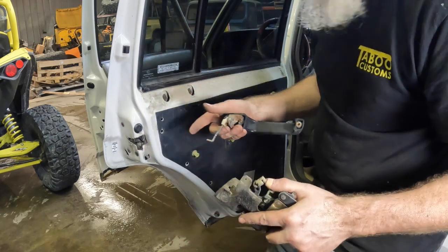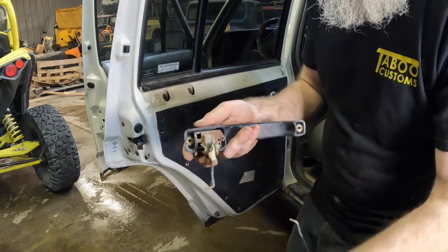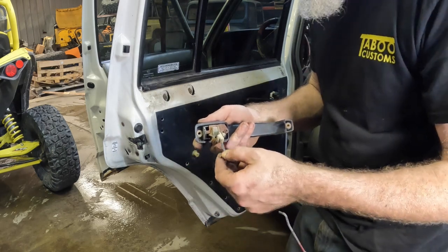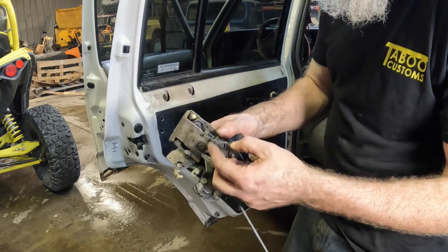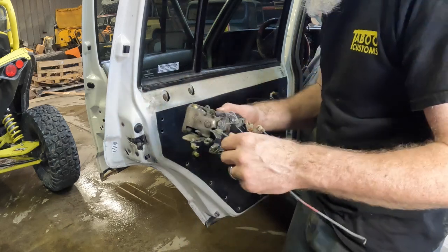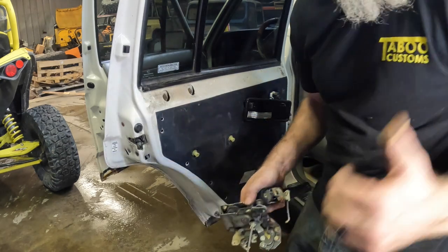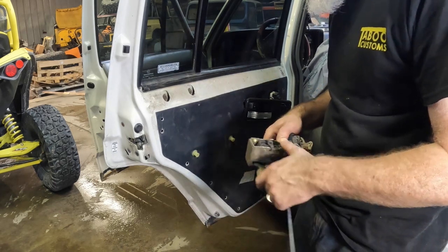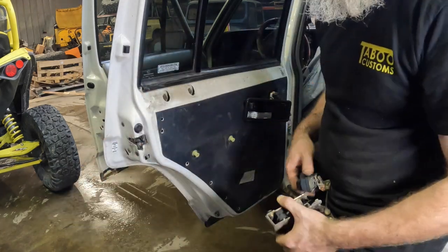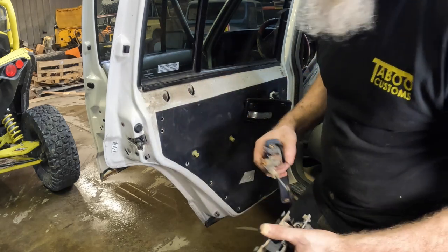Now the one on this Jeep, since the back here broke off, this whole assembly just fell off inside the Jeep. So we're going to have to fish it out of there and do basically the same thing. Be careful with this little plastic clip when popping it off, because they do like to break. We'll put a link in the description of this video to some. We've had to buy some in the past, and in some of the other videos we've done, like on the rear gate handle, those often break, and that's the reason you'll see some failures. If your latch is working correctly but you can't open the door from the outside, chances are that's possibly what's happened.